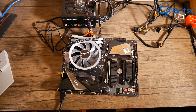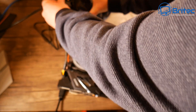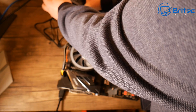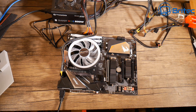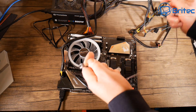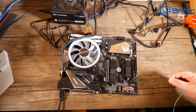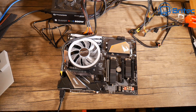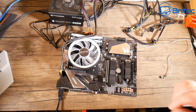Because you skip this process, it's so much easier to just do it — it takes literally five minutes and then you can get on with the build. I'm just going to plug the kettle lead into the back of the power supply and switch that on. To boot it up you need to jump these pins — the power-on switch pins. You can use a screwdriver or a tiny cable with a micro switch, which is much more professional. You just plug it into the correct power switch jumper on the board.